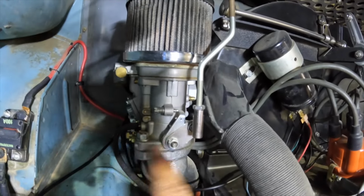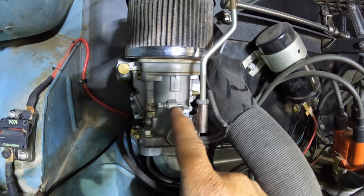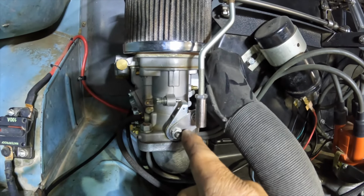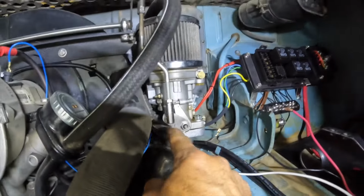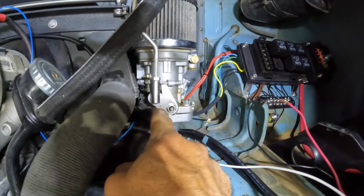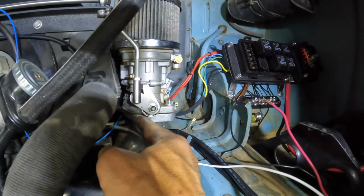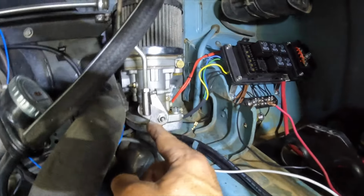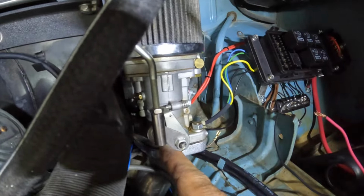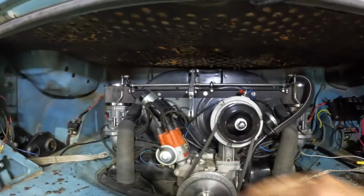So I had a buddy actually reach out to me this week. I leave the stock HPMX control on there and I cut this side of it off, so this cam can then fit on it. And then on the other side, normally there's a flange or a peak that hook goes onto for the spring. So once I've cut that off, now that hook goes onto my Berg cam right there. So everything in that video that I just did would have worked to put this 44 setup in.